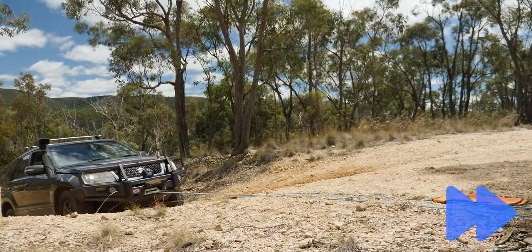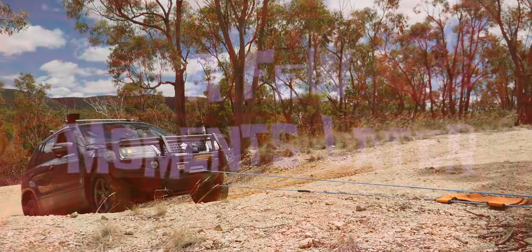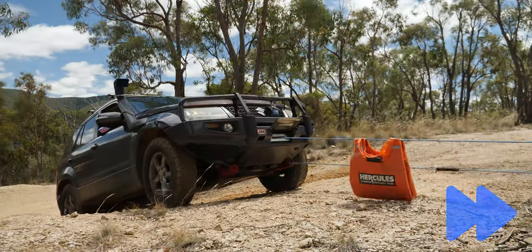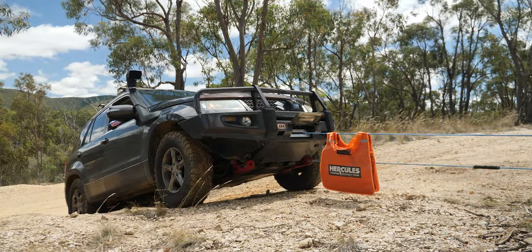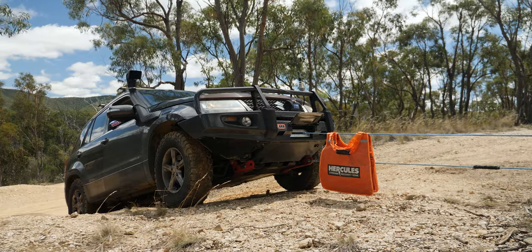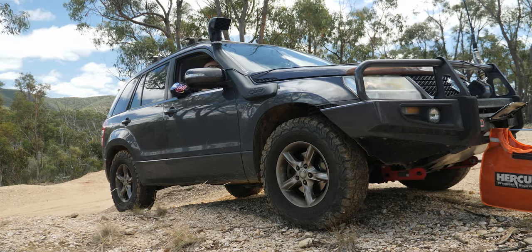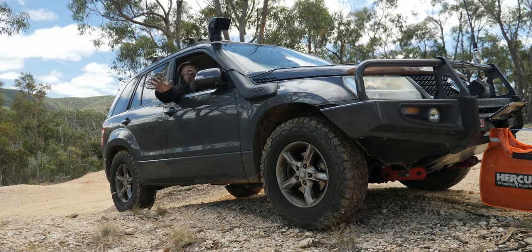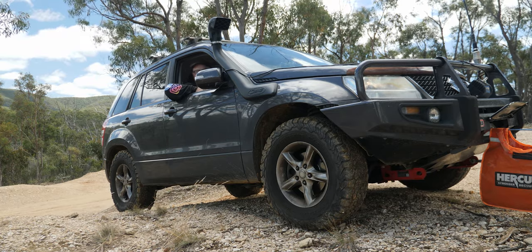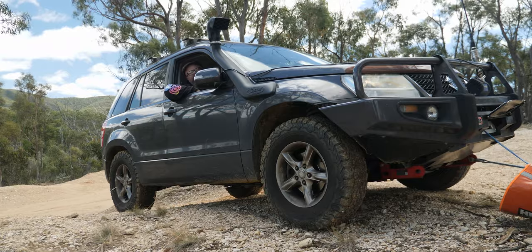Winch for 30 seconds and stop. You'll hear the difference — there'll be less stress on the winch and it'll run easier. Give it a rest, then go again. After about a minute, winch again. A few more goes and I'm pretty sure I could drive from there. Put it in neutral, park it up, then put it in park and take the tension off the winch. The vehicle sits there fine. Jump out and disconnect the winch.